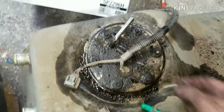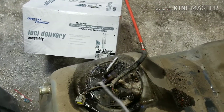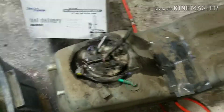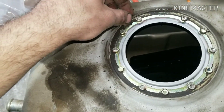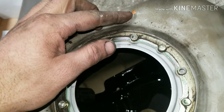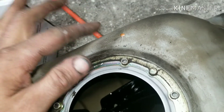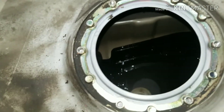Take this blue quick disconnect tool and bury it up to the hilt, then twist your steel line and it should come loose. This is the new fuel pump and we got the old one out. You have to take all these eights off and get them out of the way. First, take an air hose and blow all the debris out of the area. You can see I got it out — this is your gasket. There's a new gasket on the bottom of the new pump, and the main thing is to make sure the outlet hose for your fuel pump is pointing in the right direction. I just made a mark to note where that is.